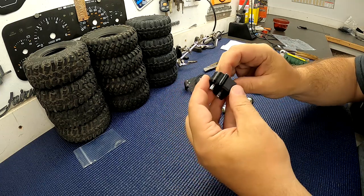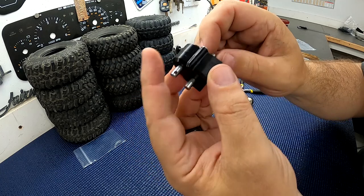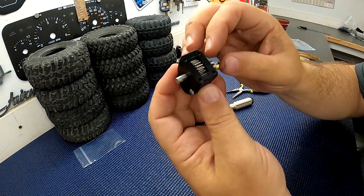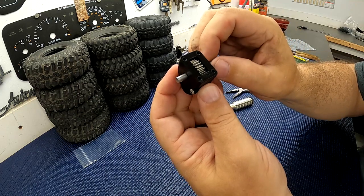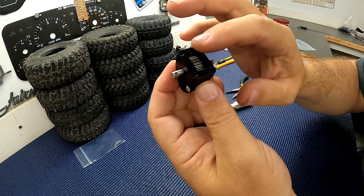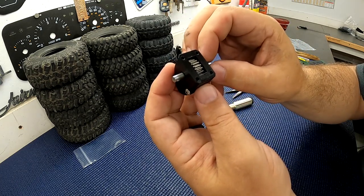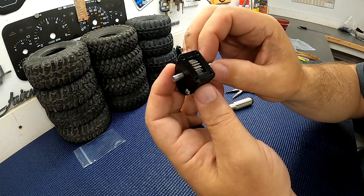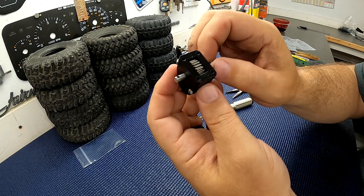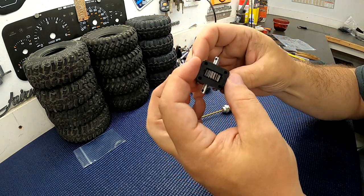There we have a nice little smooth-turning transfer case. Once it's assembled, flip it over and smear a little bit of grease on the teeth, rotate it, smear a little more, rotate. You don't want to over-grease this — it doesn't need a ton. Just make sure all the teeth are coated okay, then rotate it a few times and wipe the bottom side off so it's nice and clean.